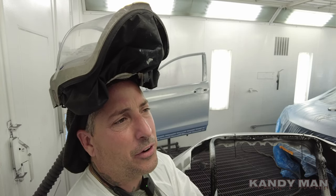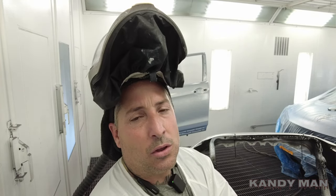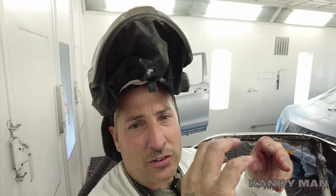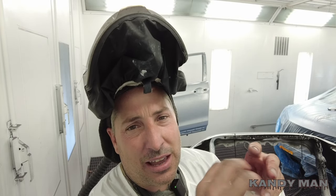The latex gets stuck in all the cracks - I don't really care for it as far as cleaning guns out. So it's nice to have this gun to just clean easily: wipe the tip, put a new cap in it. Even if you want to clean the head on it, they clean easy because they're nice slick plastic inside - you don't have to change the head out every time. I like the new feature of the head twisting on instead of having clips, because those clips would wear out. If you tried taking it off too many times, the clips would wear out and you couldn't get it to adhere good - the head would actually blow off because of the weight of the fluid cup. With the new screw head there's no wearing out, so you can take it off, clean it, and reuse it.